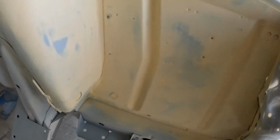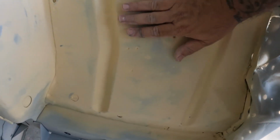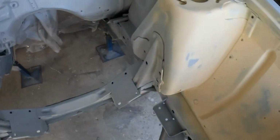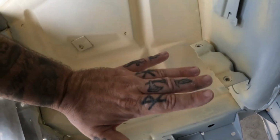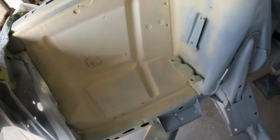Okay, it was a bit noisy yesterday and the bog goes up pretty quickly, so you couldn't see it. I filled all this. I'm really happy with how smooth that's come out. A little bit of primer surfacer on that, so that's come up straight as. This is already pretty good anyway. There was a little bit of grooving in here from, I think it must be battery acid. Eats this side away. I've seen it on a few of them now, so that's come up real nice.